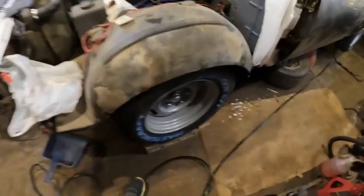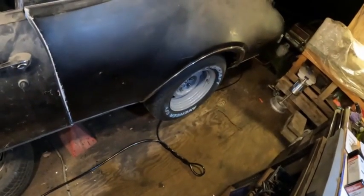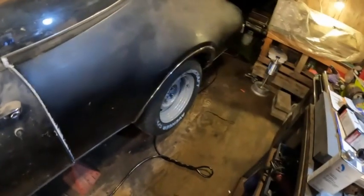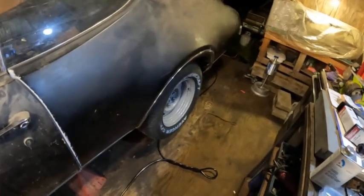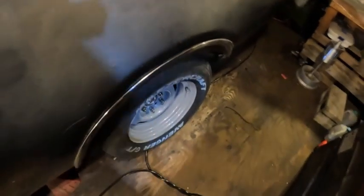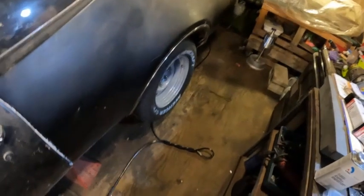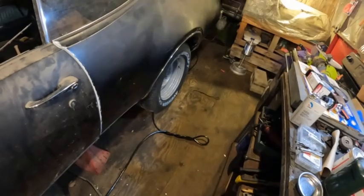Here's the wheel on the front without the fender, of course. The other side tells you more — you can see the rear wheel. I have adjustable QA1 upper arms on this, so until the full weight of the car is on and I set my pinion angle and center the rear end, this side seems to have a little more room than the other. Sometimes the body has to be shifted too, because the body was taken off to replace all the body mounts.